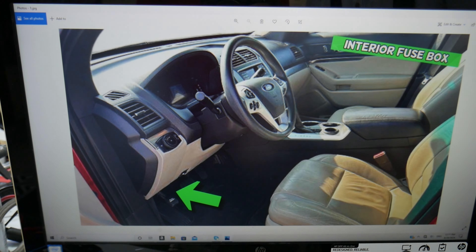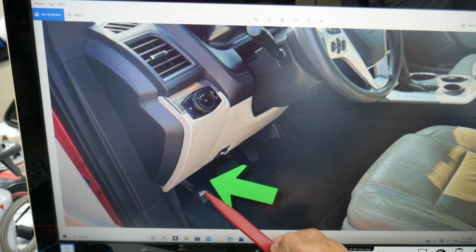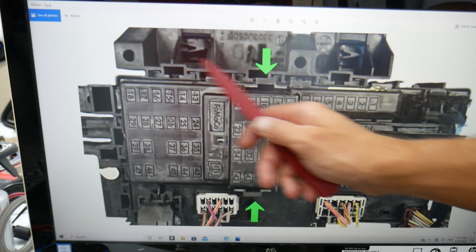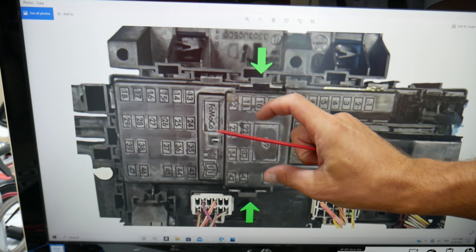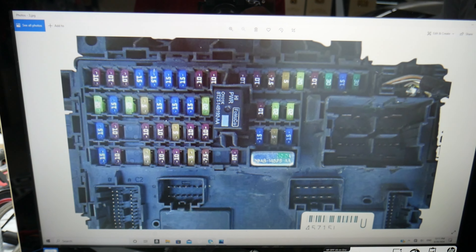You can see where the parking brake pedal is located. Look under the dash on the left side, all the way up, and you're going to see one black cover. Press these two tabs together, and behind it is the main interior fuse box with a layout like this one here.